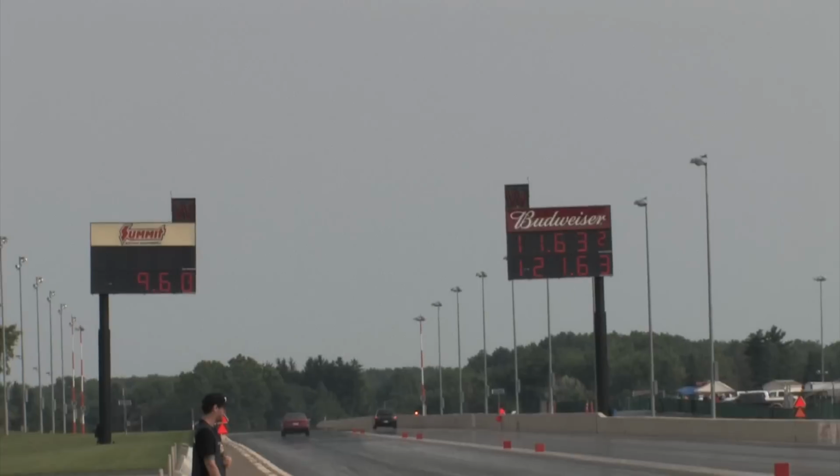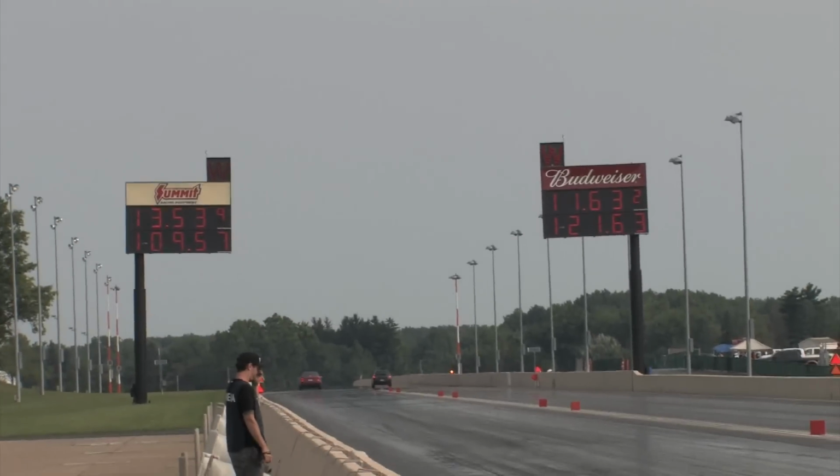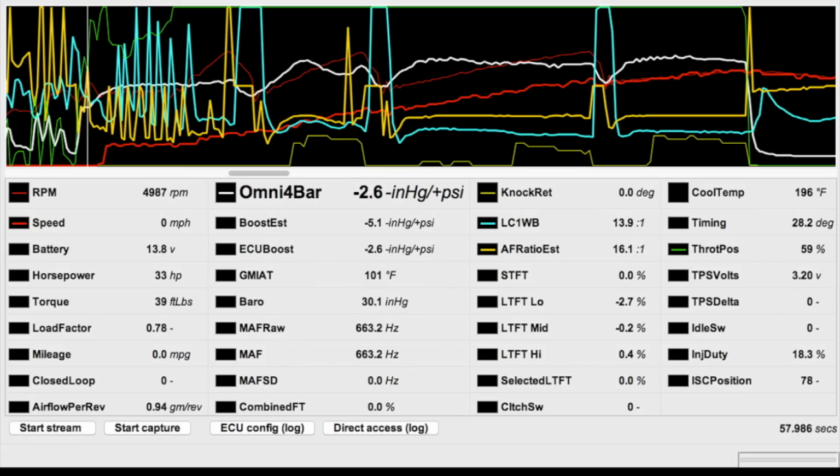Okay, so I'm starting to get my mile per hour back again. Finally! 13:53 is my new best pass of the event. But now looking through the logs, it's apparent that 10.5% is too much fuel to pull out.